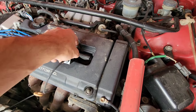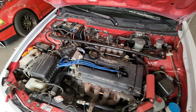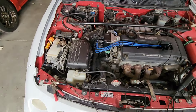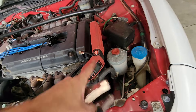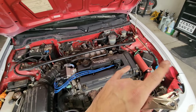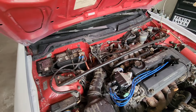You want the little clamp on the timing light as close to the plug as possible — get it on there and scoot it all the way forward. This is your cylinder one wire, so it'll flash the light anytime cylinder one fires. Anytime it flashes you want it to line up with that center mark on the balancer. This timing light is digital and fancier than what I usually use, so just make sure it's set on zero — you can advance and retard timing for other purposes, but we're sticking to zero because this is a stock car.